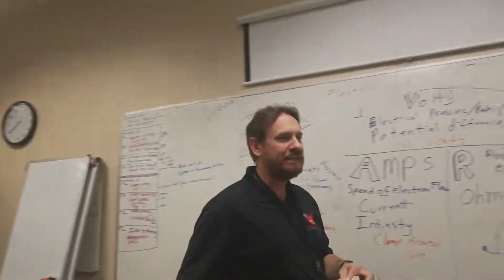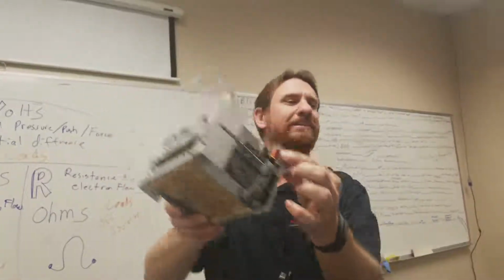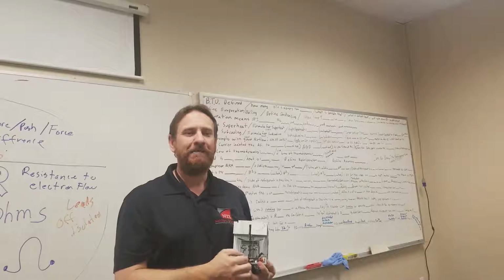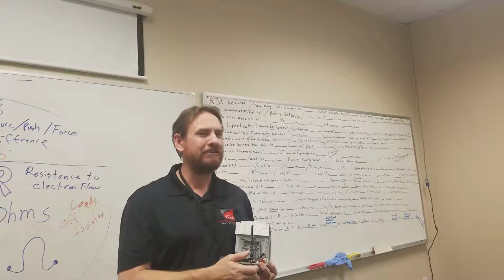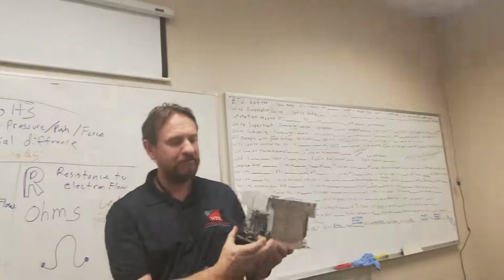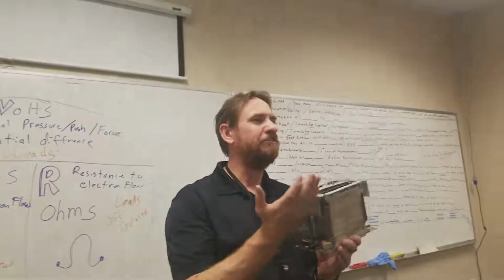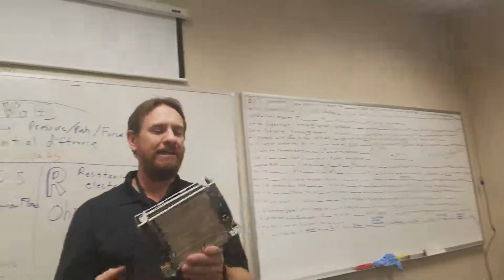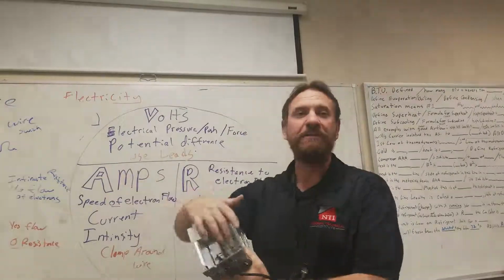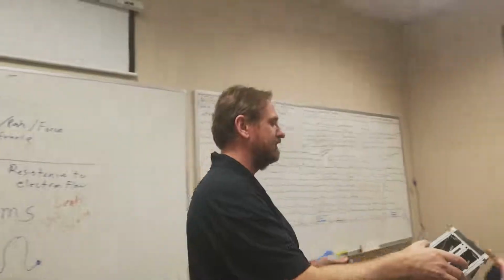There's an electromagnet right here. This little electromagnet then will energize. And when I energize an electromagnet, which is basically a solenoid, it pulls this piece of metal. And when it pulls this piece of metal, it releases the lever and the springs pull it back up. And then when the springs pull up, it also allows the switch to then open, shutting off the heater. Pass it around. Play with it. There's HVAC in a toaster.